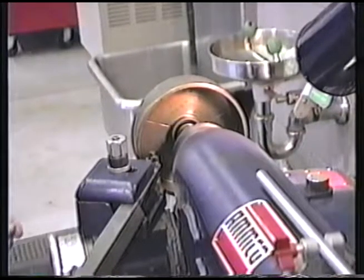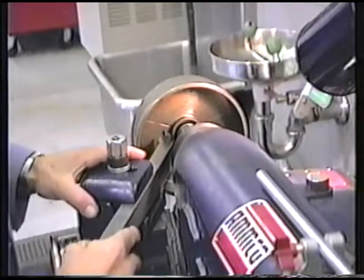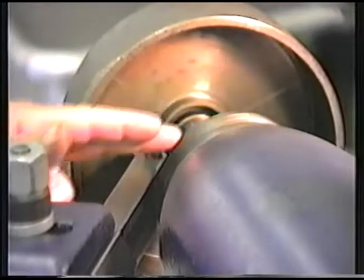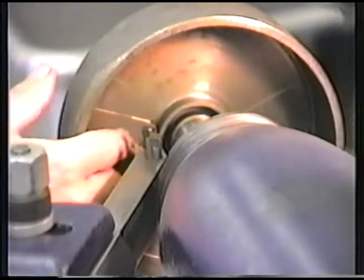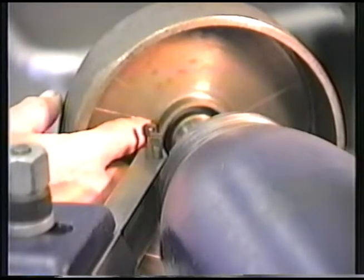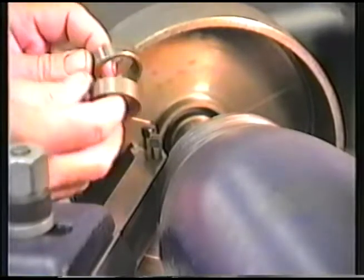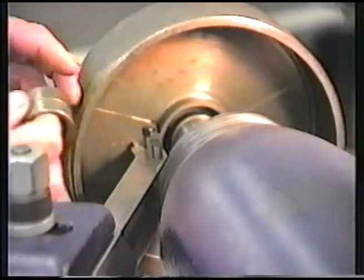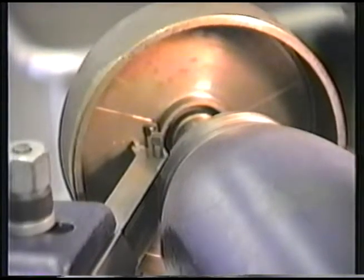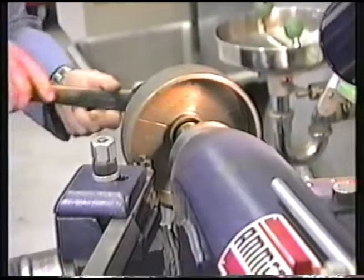To stress a point here on proper procedures, first of all, let's slide the boring bar in place, and we'll see that it interferes with a portion of the lathe, and the tool bit cannot get across the entire friction surface. Proper setup is this. We purposely eliminated putting these two spacers in to point this out. Okay, now, we'll slide this back out of the way.